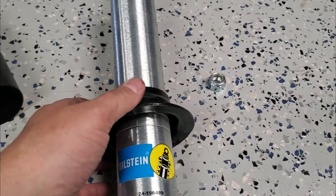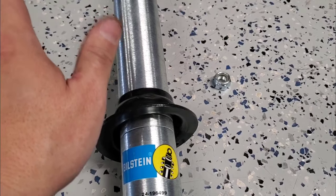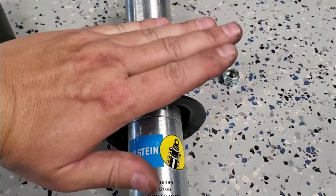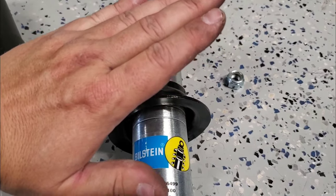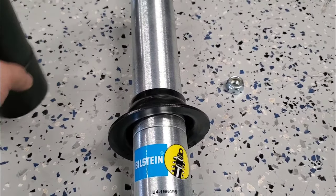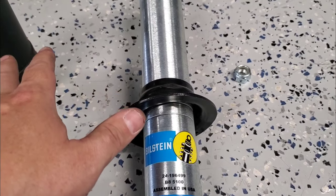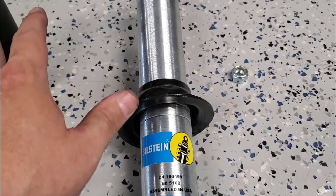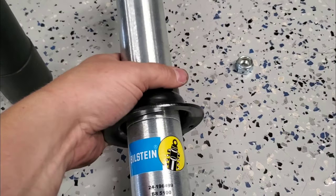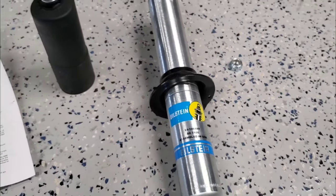The lift is created from spring tension — kind of like a coilover where you're tightening a collar and compressing the spring, putting more force down to create lift. It's a spring compression type lift rather than a spacer lift. The factory springs on the GX are way too soft, especially when towing or using a weight distribution hitch puts more weight on the nose. This is the poor man's lift — you can do it for about $370 for the shocks alone. It gives everything I want for towing and makes the springs feel the way I want up front.